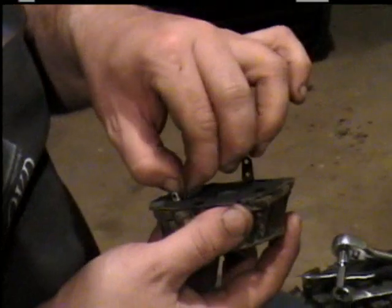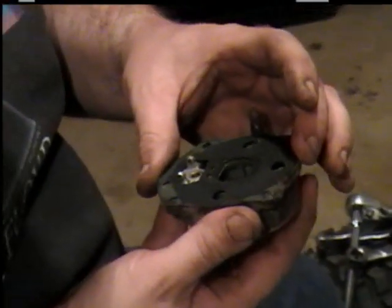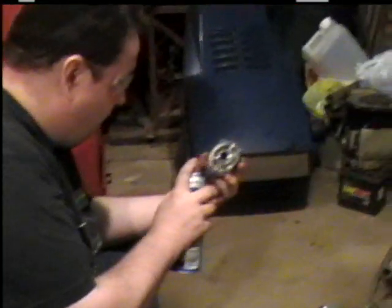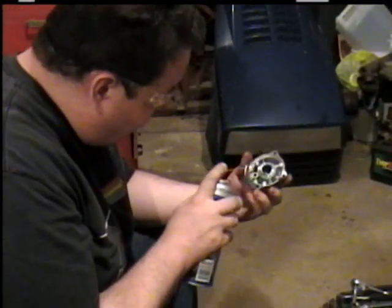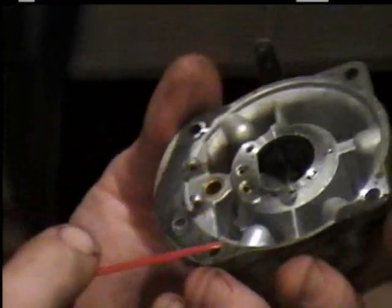And see, here's your diaphragm. Needle valve. Observe how it goes. There it is. What you want to do, start off, you always make sure you've got safety glasses in case the stuff was to fly back in your eyes. You got all the holes here. One there where your gas comes in, needle valve, there, there, and there. Then kind of clean it out and clean it off.